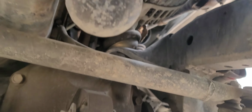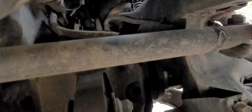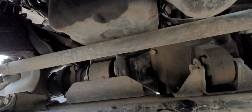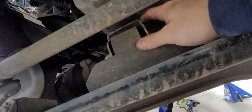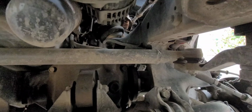Now for the four-wheel drive guys, you saw the top bolt already that I filmed earlier, but the bolts to get access to the bottom of the motor mount are right there, and I can't really express to you easily how little space there truly is. It's less than an inch. So it is going to be almost impossible to get access to that without possibly dropping the front diff, which I really don't want to do if I don't have to, because that would mean taking out this bolt, which wouldn't give you more than half an inch, and that bolt, which again wouldn't give you more than maybe half an inch to play with. So I'm going to try my best to swap out that driver's side one and just use as much mechanical prowess as I have stored in my brain.